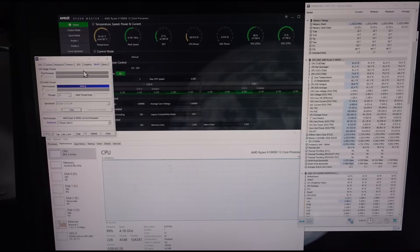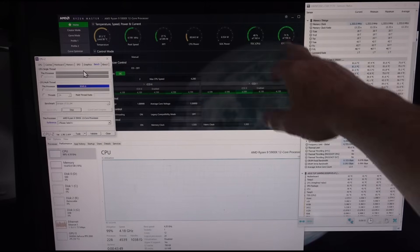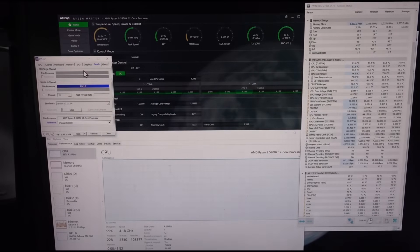I've done a few videos solving this. The last thing I did was repaste the CPU, which gave a drastic reduction in temperature. I also reflashed the BIOS, which reset and updated all the settings. Now I'm actually getting EDC and TDC readings that seem correct, and the CPU speed varies — everything seems to be working fine. But still, on one occasion, I have had the machine reboot again.